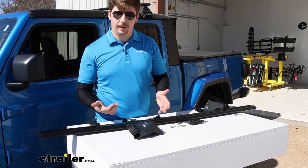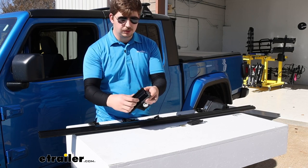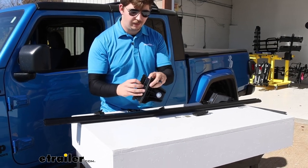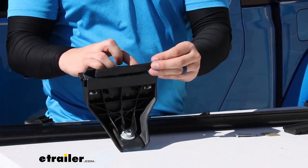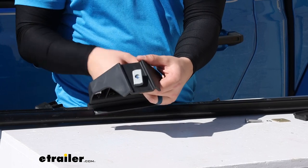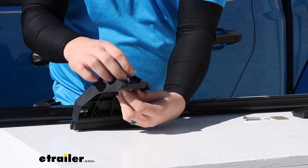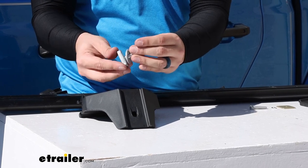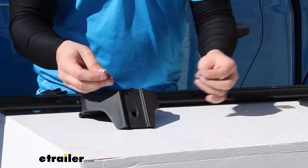The first thing you want to do is set up your gutter mounts. The screws on the bottom that hold the clamp in place — you want those loose so that the clamp can actually move around and adjust; it's just easier to get it around the gutter that way. Then we've got these rubber sleeves that'll sit on top of the piece that actually sits in the gutter, just as a bit of grip and padding. On top, we've got our T-bolt. This comes ready to go for Rhino Rack's HD bars, but we want to undo this and utilize the adapters included in our kit to make the Aero Bars work. Set these pieces to the side — you won't need them for this install, but hang on to them in case you decide to upgrade later.